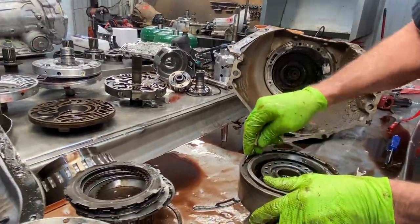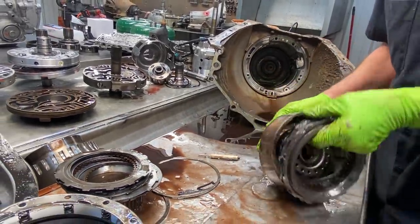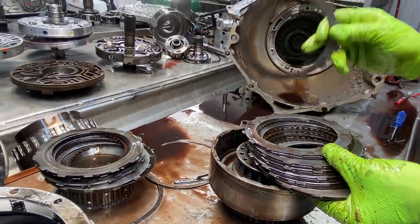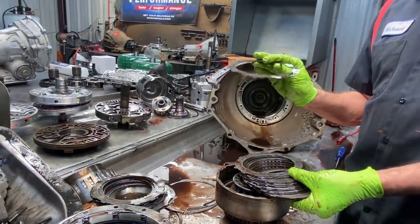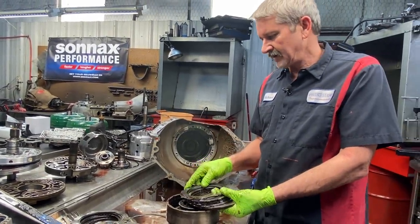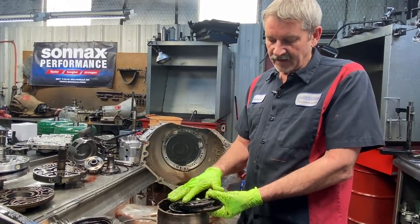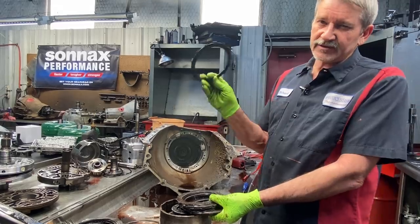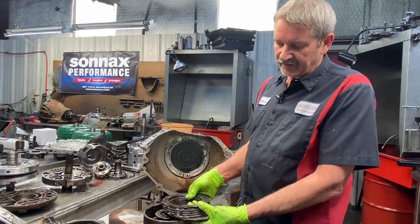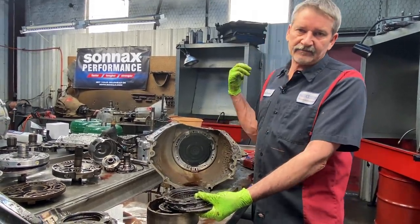We have our high gear clutch here — you notice we have a wave in this too. Why they put this wave in there is to soften reverse. It will affect third gear just a little bit, but the way the tranny is designed it's not going to burn it up in high gear. They use it to soften reverse — they can't make the band slow down, so they do it in the high gear clutch. Your high gear clutch comes on, your reverse band comes on, and you back up.